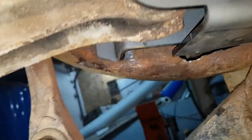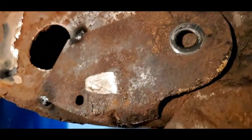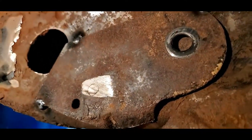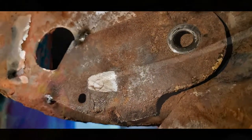Like I said earlier, you have to make sure that all the bolts go back in and it's lined up back to where it was. I bought this flat stock — most of the control arm was good, so I just cut up the flat stock to fit over where I had that little bad spot. Got it tacked on, so I'll get that welded in and then I can get my control arm in.